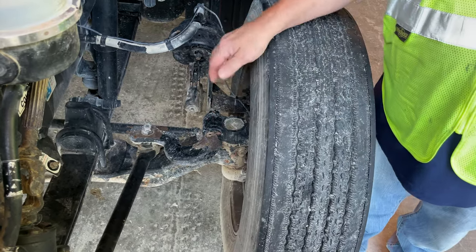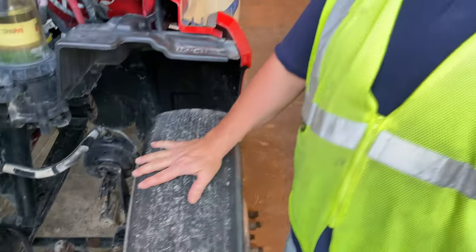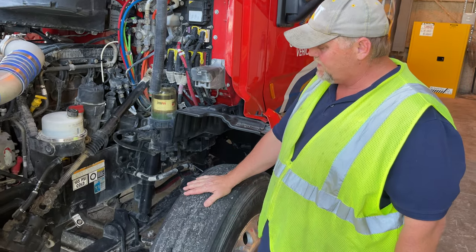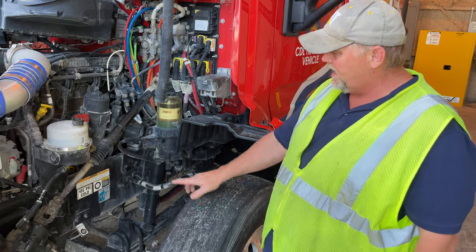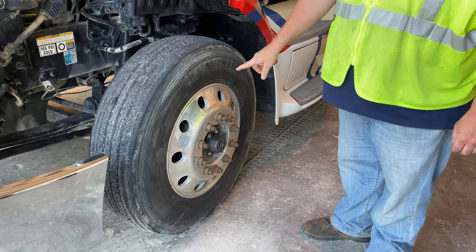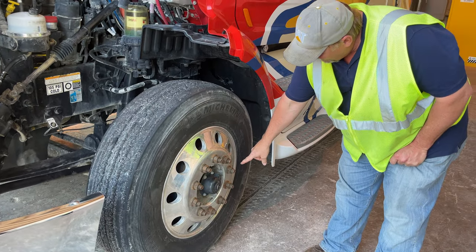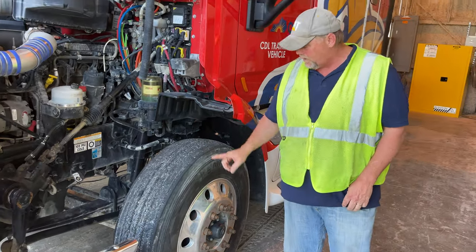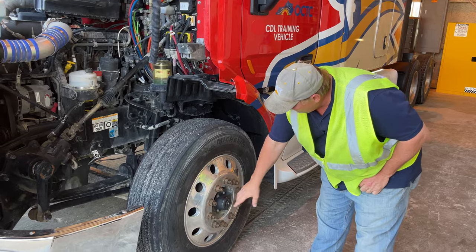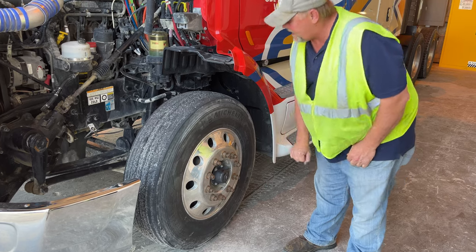The inside of my wheel is not bent, broken, or illegally welded. The inside, outside, and top side of my tire are not cut, bulged, or lacerated, and the tread is evenly worn. This is a steer tire, so it is above 4/32nds of thickness and is at 105 PSI. The outside of my wheel is not bent, broken, or illegally welded. My valve stem is not bent, broken, or leaking, and the cap is on tight. This wheel is secured to the truck with 10 lug nuts that show no rust trails or shiny spots to indicate looseness. My wheel hub is filled to the manufacturer's level, the cap is not cracked or broke, and there is no oil slung to indicate a leak.